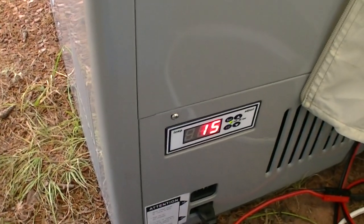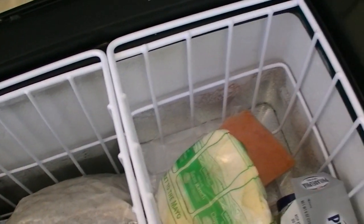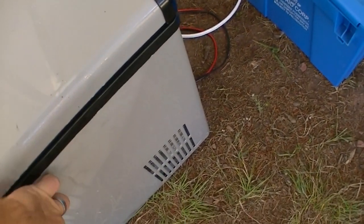Let's show you what the freezer looks like inside and how it's working. It just shut off — it's at 15 degrees right now. Everything is still running hard. There's a little bit of ice on the side but it's running great. This is day four. As soon as the sun comes out, I'll do another quick video showing it charging at about 150, 160, 170 watts — it might actually hit 200 at first before the solar panel warms up and derates a little bit.